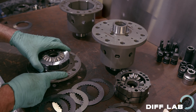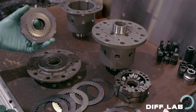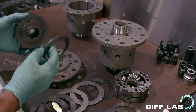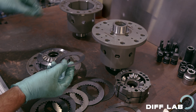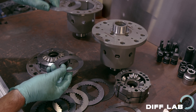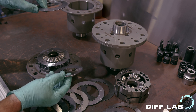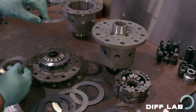I'm not going to tear the rest of this down because the rest is the same — these are symmetrical units, meaning everything on the right is also on the left. There's the end spring on the other side, which illustrates the way the entire stack is floating between two springs — one left and one right. So the whole stack can actually move very, very slightly. This one will take up most of the free play as one side wears down; the other will take up free play as the plates on the other side start to wear down.